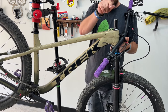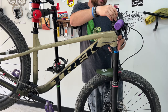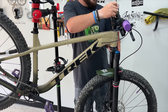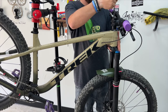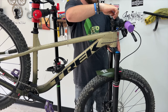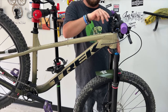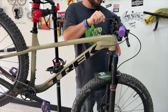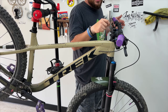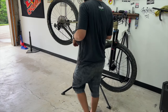Got my dust cap, two spacers with logos facing outward, stem, and one spacer on top, then the top cap. You should always have a bit of space between the stem cap and the steer tube. Take your compression cap and twist it until you feel it pulling in — it doesn't have to be super tight. Too tight and your steering won't flow freely; you'll crush the bearings. You just want to compress them against the top and bottom. About finger tight — the torque spec on this one is four Newton meters max.